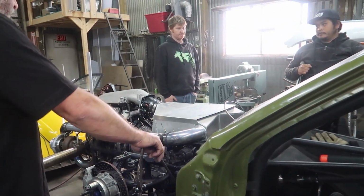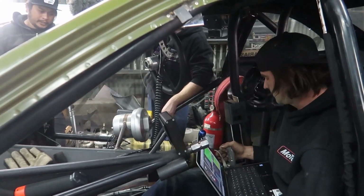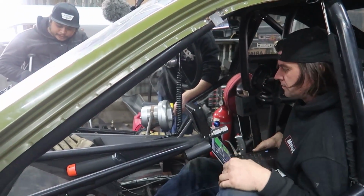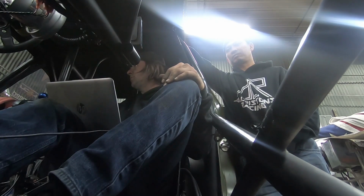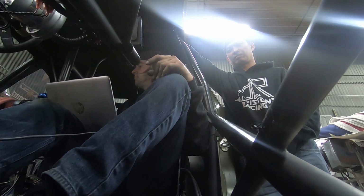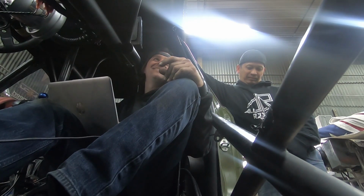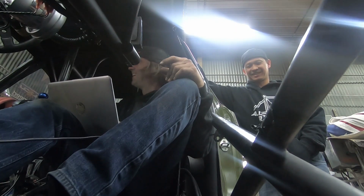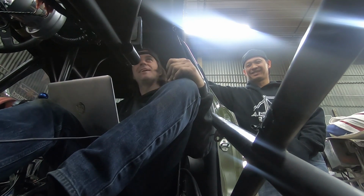Yeah, because it didn't shift back down. No, it says to go to neutral and then back. Yeah, you have to reset it manually with the valve. Yeah, reset with linkage. So you got to remember to do that when we're out of the shift zone. They say go all the way to neutral and then back to low, back to second, back to low. It's a procedure. Otherwise, you're launching in second. You're going nowhere. Hit the juice. Whoa! Yeah, that's when you need the juice in case you accidentally do that.